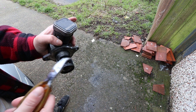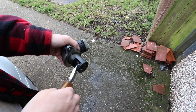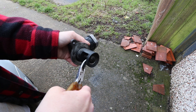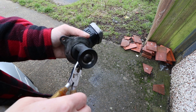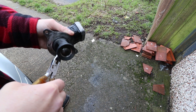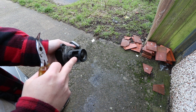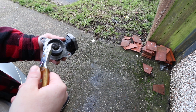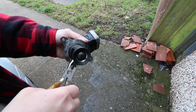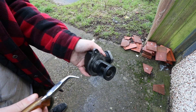It's just a mechanical valve — there's nothing electronic here, so just keep everything away from the connector end. To verify its operation, get some pliers in there and lever it up — I can see the valve is opening. You can see daylight through it. It doesn't open massively like a thermostat; it just opens enough to let stuff come in and be recirculated. I can verify it's moving fine and the system will exert a lot more pressure than that, so I know it's working. I'm going to put that back in the car now.